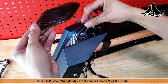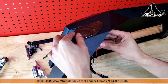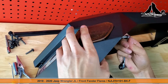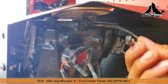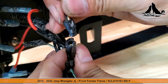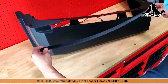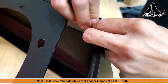We're now going to attach the OEM side lamp into the front fender using the same original OEM screw. We then need to reattach the electric clip that provides power to the side lamp by clipping it back into the main set of clips. Last step, we just need to insert this rubber strip for a tighter seal for the fender against the Jeep body.